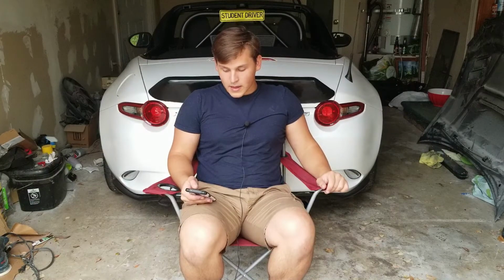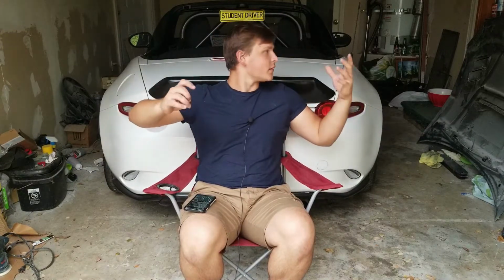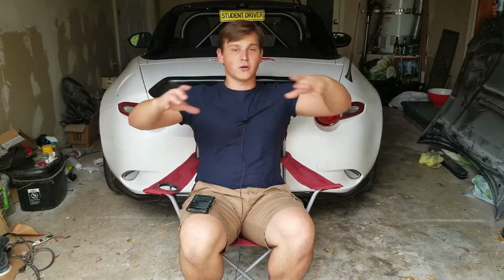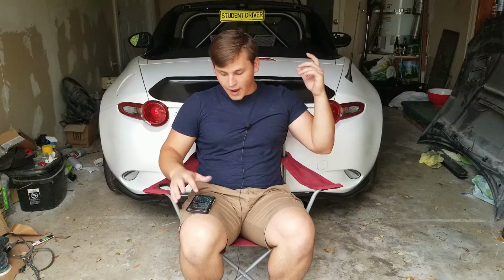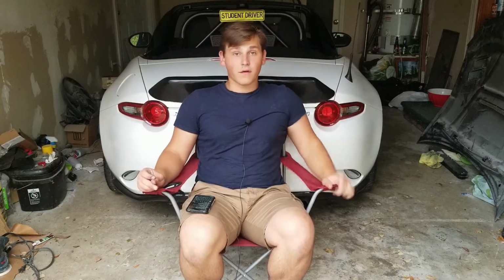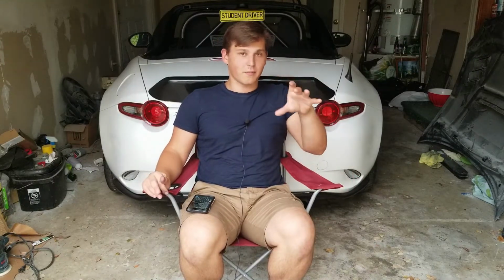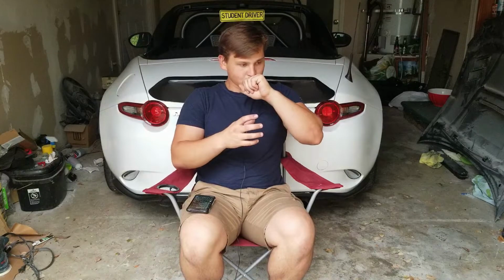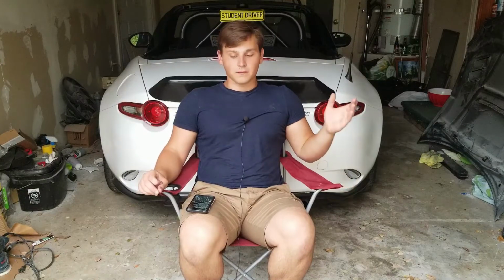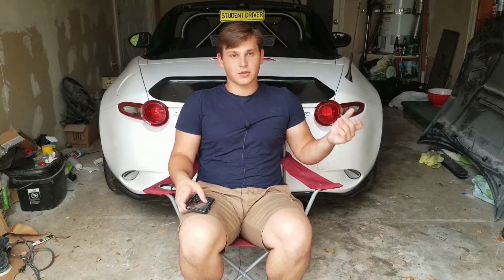So step 2 is I covered the general area at the back with expanding foam. I'm going to link it, but basically the idea is to make a general shape with that foam. And then after I made the foam, I had to cut it out. Also, a quick tip about the foam is you're going to want to do multiple different layers, because I found that if you try to do it in one big layer, the center is not going to harden. It's going to stay soft, or it's going to take a long time to harden. So if you do several layers, like 3 or 4, then it will take less time to harden than if you just try to do one big blob, and it will harden in a much more even fashion.